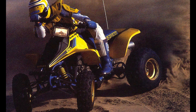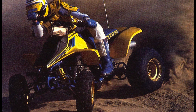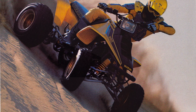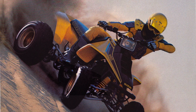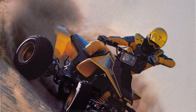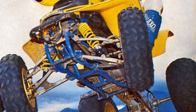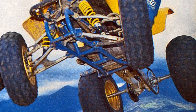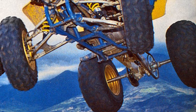The stock alloy silencer was super trick and nodded to the machine's performance intentions — slightly louder than the steel units on the competition, but much lighter and still off-road legal. The triple disc brakes worked extremely well, and several testers commented they wished the RMs had come with similarly powerful units. Underbody protection was all but non-existent, with only a flimsy cover on the rear rotor. Bent sprockets, busted rotors, and cracked cases were a major concern for anyone planning to ride in rocky environments, and unless you were only riding in the dunes, aftermarket skid plates were a must.